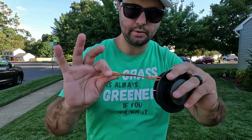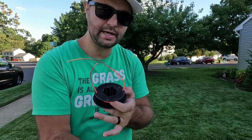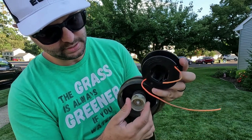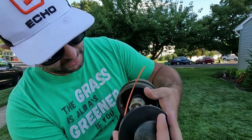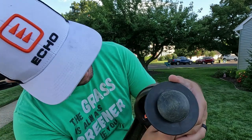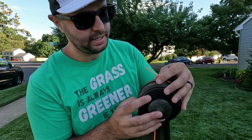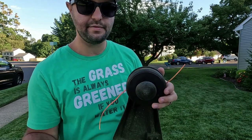Once you get up to a couple inches long, clip one end and then clip the other end. From there you can throw it on the actual head of the string trimmer. Once your spool is all lined up and nice and tight, there are little grooves in here that you line up with these nipples. To make life easier, turn these nipples to match the different holes so that when you put your spool on it's easy to tighten up. Feed it back on — I usually do this on the ground. Push the head on and tighten it up. If the cord is a little bit longer, just clip it with needle-nose pliers, scissors, whatever you've got, and you're good to go.